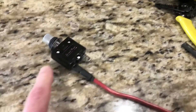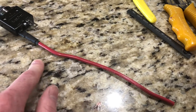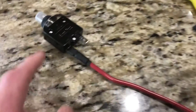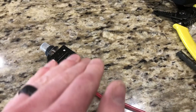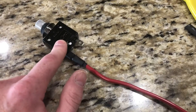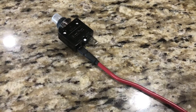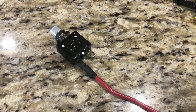One important thing: the circuit breaker or fuse should be as close to the battery as possible. For example, if the tongue jack is extended to its highest setting it will draw more power. If it draws too much power, you want that to hit the circuit breaker right at the battery — not near the tongue jack, because then electricity would have to travel the entire wire length before the breaker trips. Keeping it close to the battery will protect your wires from electrical damage.